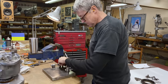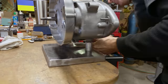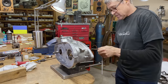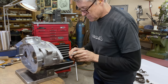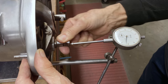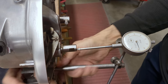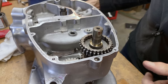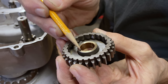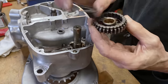This is my little cub engine stand — very handy having a stand. I've got a dial indicator set up on the end of the shaft. We've got about 6 thou of end play. As long as it's not excessive — when I started this it had 2 thou. To get the extra movement, I put this piece in the lathe — it's hard metal, but I took a few thou off right there with a carbide tool. That's how I got the 6 or 7 thou end play. This is a shim that goes in there.